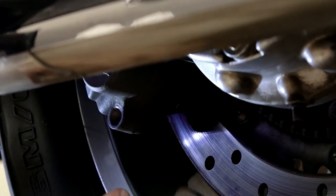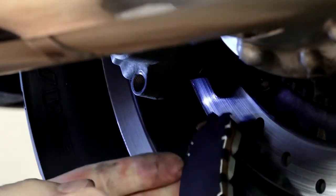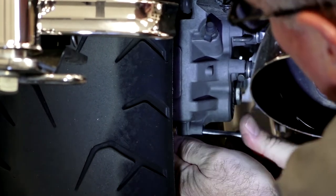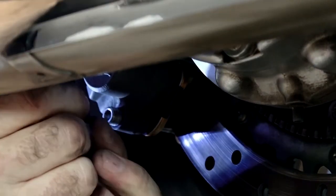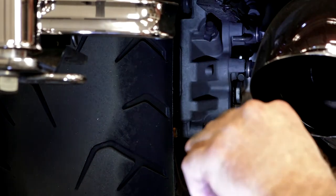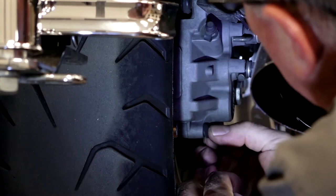Feed the inside one up first, pushing in on the caliper a little bit. Now we can pull out on the caliper and go with the other side. I've got them both held up — go ahead and put the pin through. There's one, there's two — now they're in. Grab your 5mm Allen and bring it back hand tight until it bottoms out. Then grab your torque wrench and set it to 13 foot-pounds. Next, get the little rubber stopper put back in.